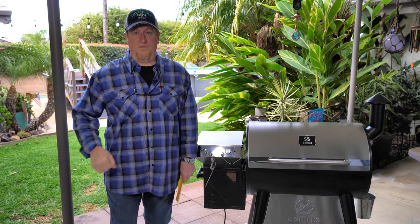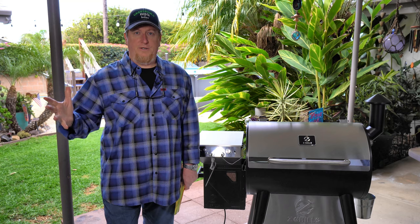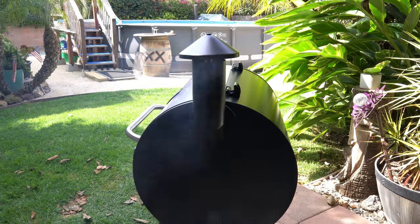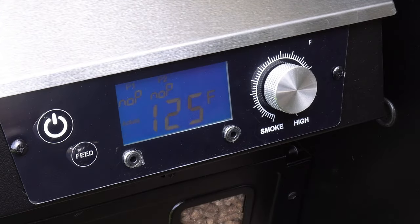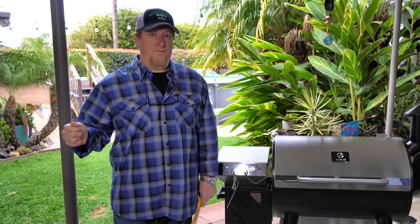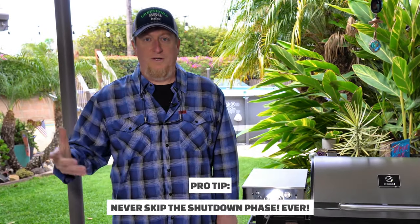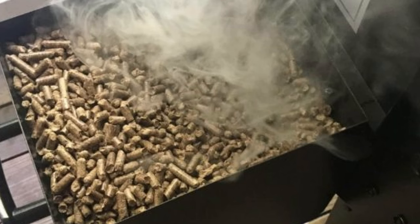Once it's completely cool, add more pellets if needed, then reassemble all the trays, grates, and close the lid and turn it on. It should immediately go to 275 as the default temperature setting. Once smoke appears, turn it all the way to high and let it run for about 45 minutes. This will burn off any remaining oils and residue. Then turn it off via the app or control panel. I like to open the lid — it's going to run for about 10 minutes during the shutdown period. These shutdown periods are very vital to the health of your smoker. There are many stories on the internet about auger fires and smoke fires, usually because of an improper shutdown process or not taking care of your pellet smoker, which we'll cover in future videos.